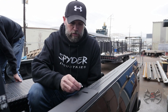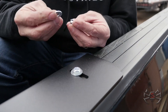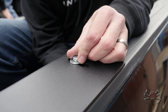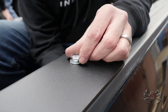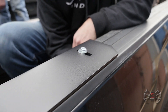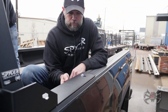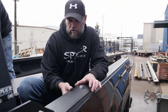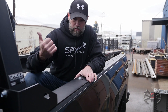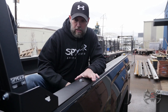At this point we would put the back bolt in, which is a 5/16ths bolt with a washer on top and a washer and nut on the bottom, then tighten that up. Now in this case we have a toolbox, so we've got to line these holes with either the holes in the toolbox or drill new holes in the toolbox so we can bolt and sandwich all the way through. The other option would be to j-hook the toolbox onto the bed rails, but you'd still need holes through the toolbox for it to sit flush on top of the bed rail.